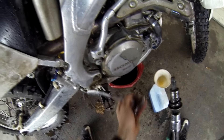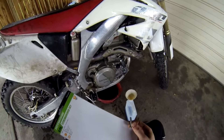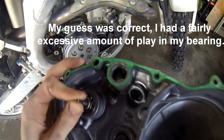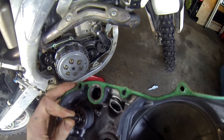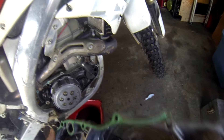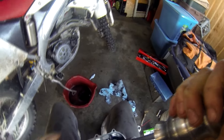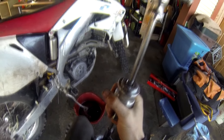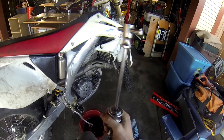We're going to move on by taking the right side cover off. A quick tip to keep track of your bolts: take a piece of cardboard, poke holes in it with a knife, insert each bolt into the corresponding hole, and create a template of what your right side cover looks like — you'll never lose your bolts again. Now with the right side cover off, we have access to the impeller shaft, oil seal, and bearing. We're going to want to replace all of those, including the impeller shaft — even the slightest nick or burr on the shaft can create an opening in the seal and cause leaks.